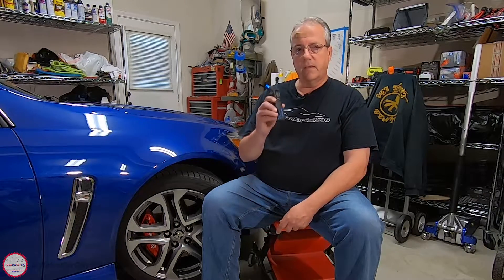Welcome back to the channel. In this video I'll be discussing proper tire inflation maintenance, which includes utilizing a TPMS or tire pressure monitoring system if your vehicle is so equipped, how you should still be performing tire inflation checks using a regular tire pressure gauge, and if you do have a direct TPMS system with sensors in each wheel, how you might want to take a little socket and check the sensor tightness. After the introduction we'll go through direct and indirect TPMS systems and how they're different, and then talk about where you can locate the proper inflation values for your tires.